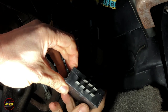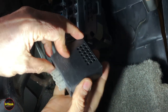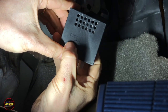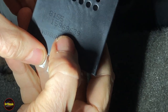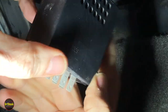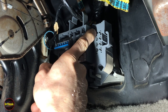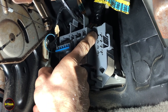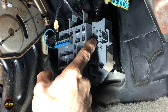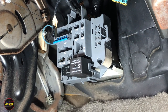There are seven male connectors on this module, and the original part number from 1998 is 15969639. This module plugs in here — J4 is here, and there's an unused cavity you can use to orient yourself with the picture. The other way to orient yourself is to find K2, which is the ground. Let's tone that out and make sure.